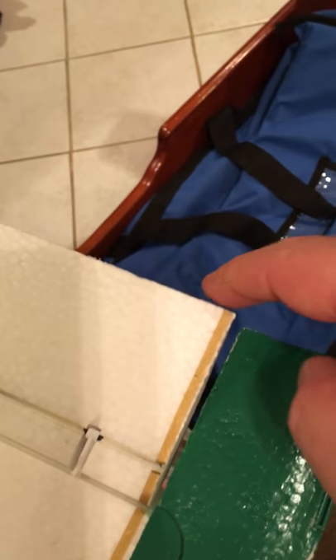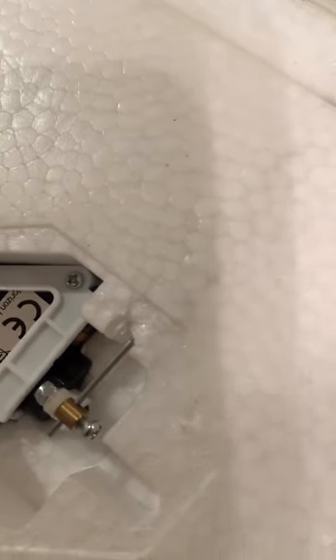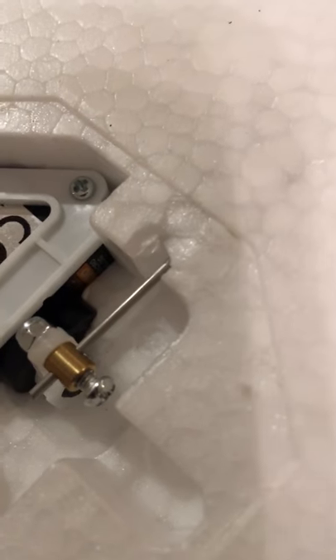As I was trying to land his airplane I had the exact same problem. So we figured something in the ailerons was the issue — and it came back to something everybody else has talked about: slop in the ailerons. Here you can see I've got virtually no slop because we repaired this one. If I move this aileron, you'll see the servo arm is moving with no slop.